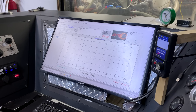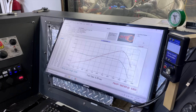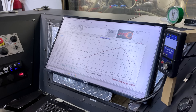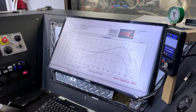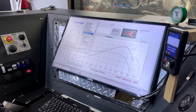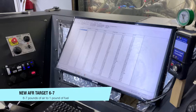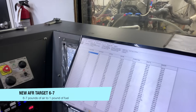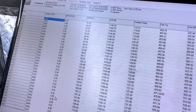It is so rich it's unbelievable — we've got to get some fuel out of it. Pulling a report, I don't think it ever gets to where it should be — somewhere in the high 6s, low 7s — I'm going to bet we're in the 4s. There's enough fuel there to run an alcohol funny car. It never leans out; it just goes rich, rich, rich and richer.